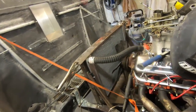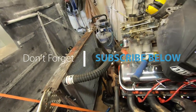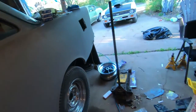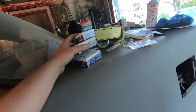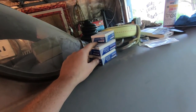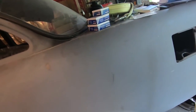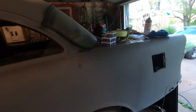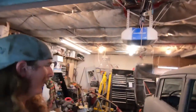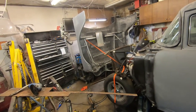This has beaten me but there's enough there to run the car. I'll take it all apart and properly paint it black when I get to it. I ended up picking up a bunch of conversion U-joints - I've got to go from the 1350 yoke down to whatever the G-body uses, then back to a 1310 for the factory rear end. That's what we're working on next. Subscribe to the channel, like the video, tell your friends - I really appreciate it, and I'll be back doing driveshaft stuff.